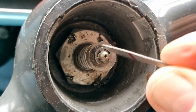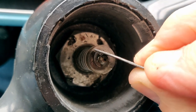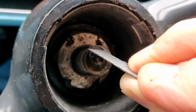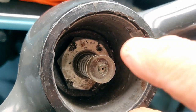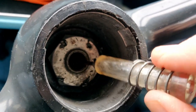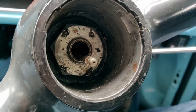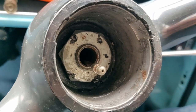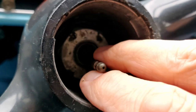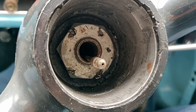I'm going to start by removing this circlip, and you can take off the insulating part and the spring — put that somewhere you won't forget. Then I'm going to put a bit of masking tape around here, otherwise the horn is going to go off every time we short something.